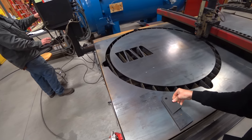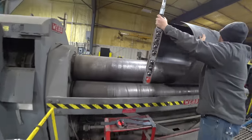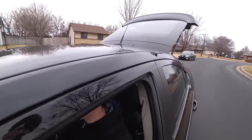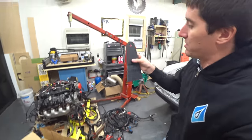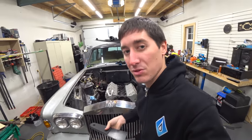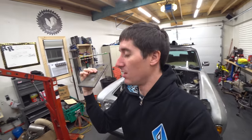Magical motor mount extensions — look at that. Much larger and it tapers down. Huge thank you to American Control Engineering Service for using their metal stretcher and turning our short little mounts into these larger mounts. These things will mount right down there on the rack, and it's time to do some cutting and welding. We're going to trim these to fit — take a little bit of metal off the bottom until it fits in there.